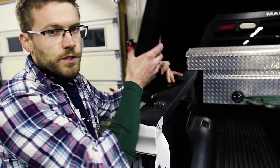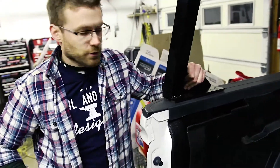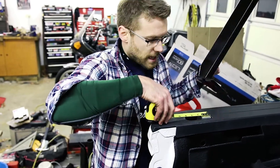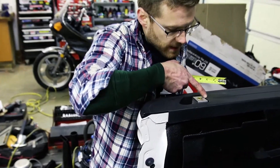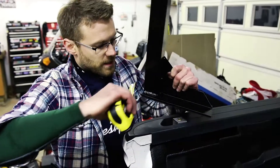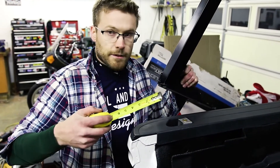Now we need to measure where we're going to drill these holes — they do not have any pre-drilled holes, so we need to make sure we get them lined up exactly where we want them. This will vary depending on your particular truck. What I'm going to do is wrap the tape measure around the edge, line this up where I want to install it, measure that distance, and then measure the difference between that edge and the center of the hole — that's just about three-quarters of an inch. Subtract that from the outer measurement: I measured five and a quarter inches, subtract three-quarters, and I'm down to four and a half inches.